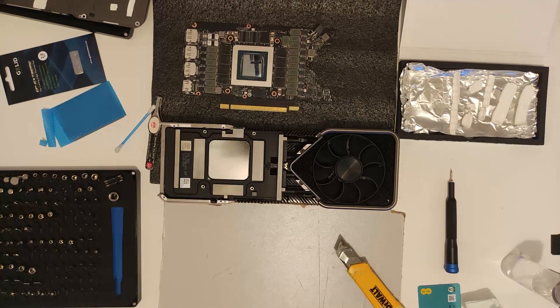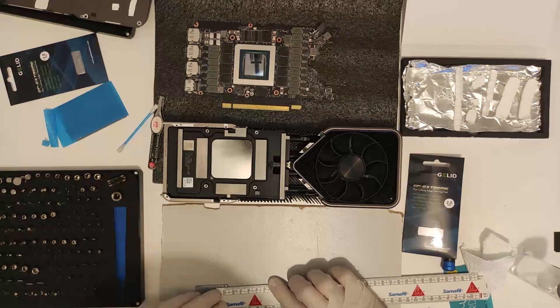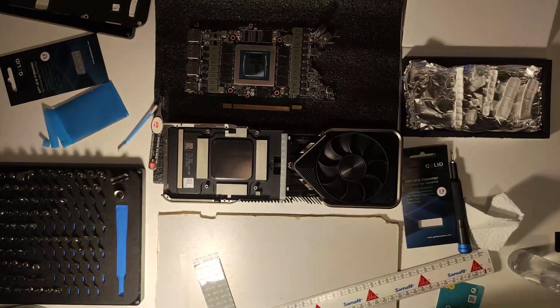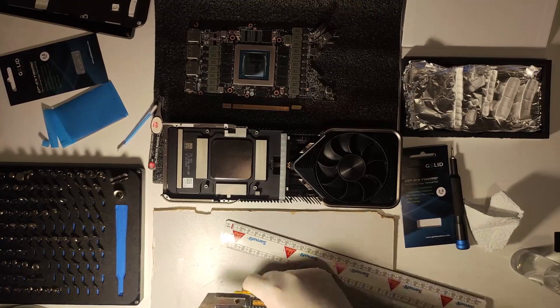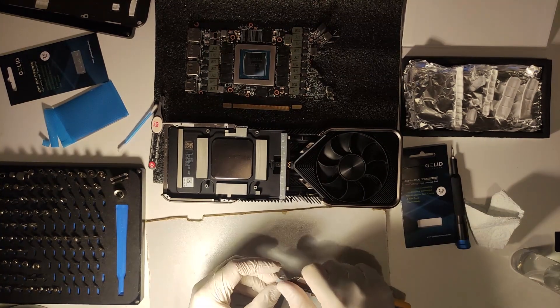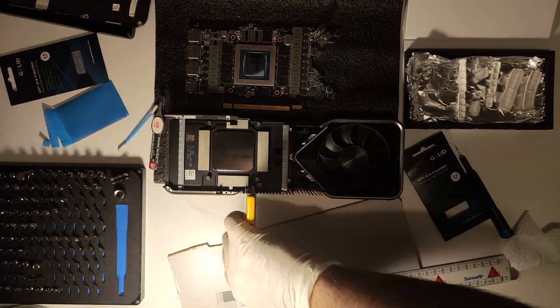Now it's time to start the reassembly. A really good knife is required, along with a vernier caliper ideally, but a ruler is alright if you don't have one. I'll link in the description to a template made by someone on Reddit — all credit goes to them. The thermal pads are sandwiched between two types of plastic: a tough sheet on one side and a peelable foil on the other. If you have a proper knife, start cutting from the soft side and cut all the way through. If not, start from the hard side to avoid deforming them. Peel one part off when sticking them down and leave the plastic on the other side to peel off just before you clamp everything back together — that way no dust settles on it while you work.